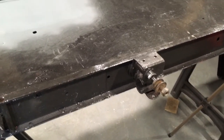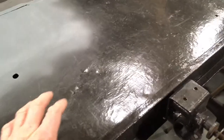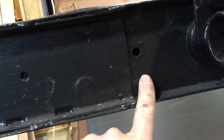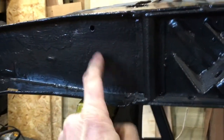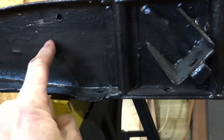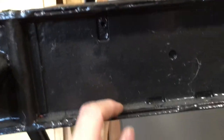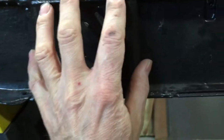If you think chassis, I tend to think ladder chassis, big heavy steel girders, and with maybe a top cover here to keep the dirt out from the inside of the ladder. But the reality is, right here, you can see there's a plate that runs across here. And it's thinner again here. So you've got this thin steel here, and this is probably 1mm, same as the rest of the chassis. And here it's got a stiffener plate of a much thicker U-shaped piece of steel. But when I say U-shaped, it's only about 20mm depth here, and this is the stiffener plate. And this stiffener plate is here because this is where the suspension bolts on.